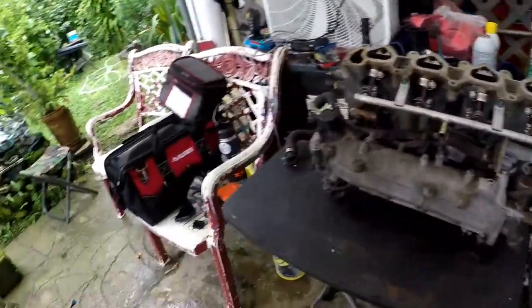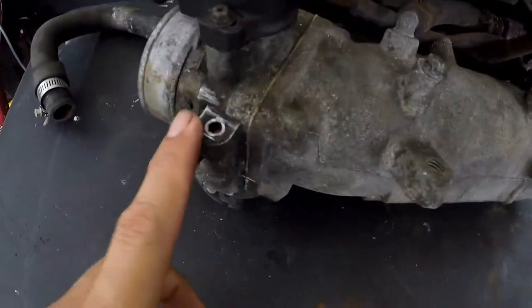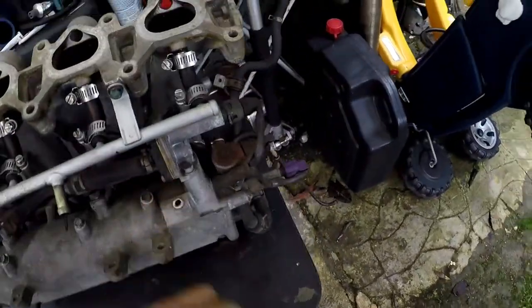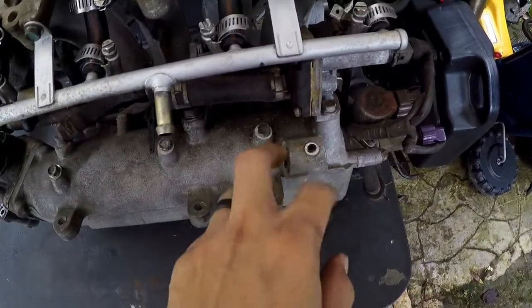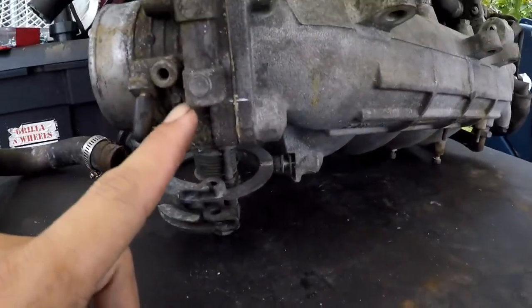Let's talk about what just happened. So I grinded off the coolant ports here, here, the one on the throttle body, here and here. It's not needed because it was running through those hard lines — the ones located over there. I decided to cut them off so it's a little bit cleaner, and if I need the space, those ports won't be blocking.